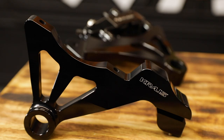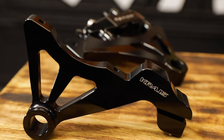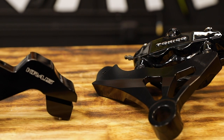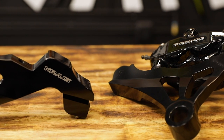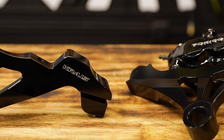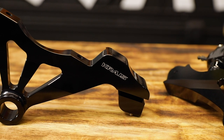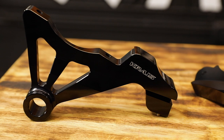I'm really digging their radial caliper mounts. These radial caliper mounts allow you to use a 108mm Tokico, Brembo, whatever 108mm radial caliper you choose, and mount it to almost every bike. They have custom applications for 25mm, 1 inch, or they have setup configurations for your bike — they already have a Dyna setup, a 2018 Softail setup. You just put it in place with the traditional brake stay on your swing arm, then add the caliper, plumb it and all the fun stuff. Really cool products from them. Nice and clean.